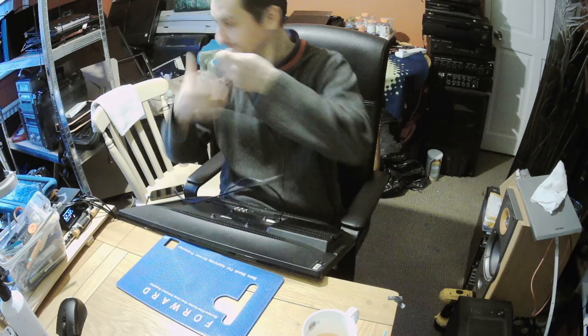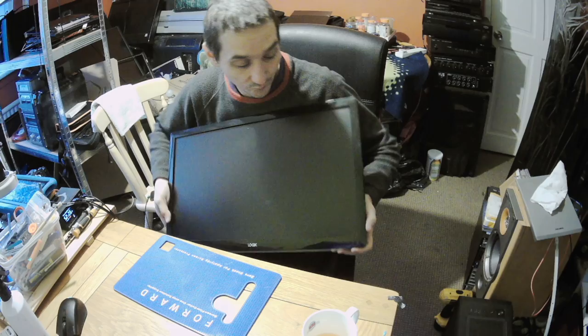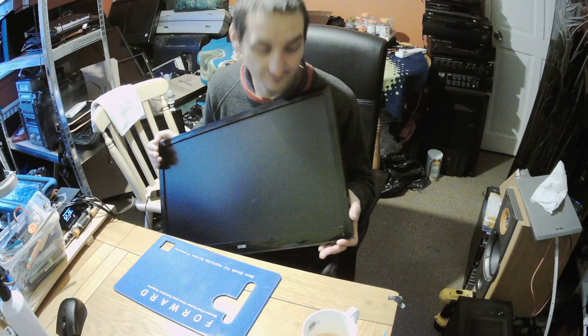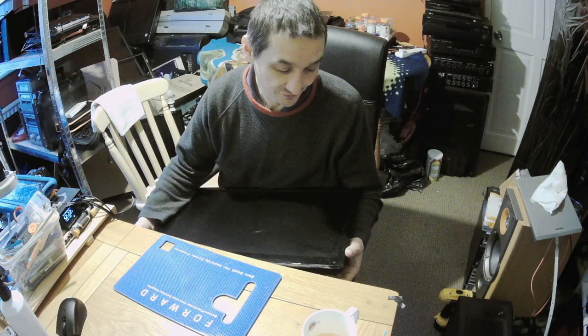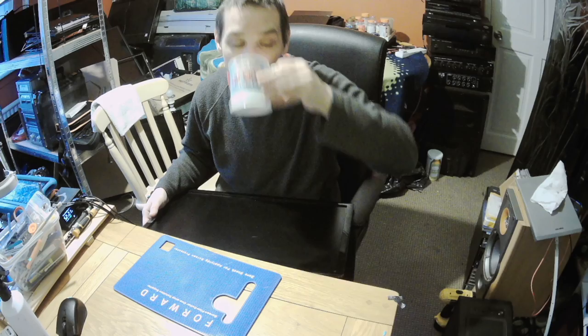I've been told that it has no power. Let us verify, because we don't trust customers — sometimes it's as simple as a restart. Okay, I've seen a blink — blue LED. Is there a power button on this? No. Yeah, it's just blinking a blue LED, that's it, nothing else, and it's random, or at least 5 to 10 seconds. Yes, so I can say that there is no power — but the question is why. Is it because the power supply is faulty, or is it because the backlight is faulty, or the backlight section in the power supply?